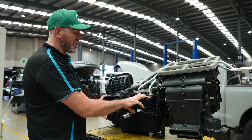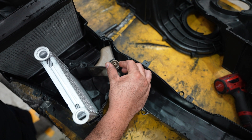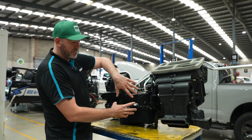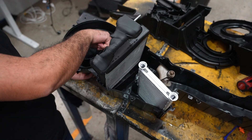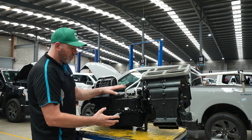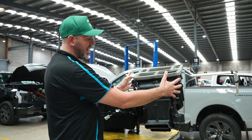Moving past the heater core, next to that you'll have two motors — one up the top and one down the bottom — and these both drive what are called blend doors. When you change the temperature dial on the HVAC controls, these two doors control the flow of air between the heated and non-heated side of the heater box. There are two channels: one passes through the heater, one passes through just the evaporator, and then onto the distribution head. Once temperature has been controlled by the blend doors, the air passes into the main body of the HVAC.